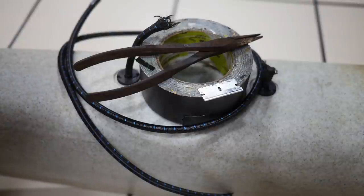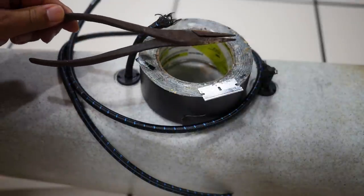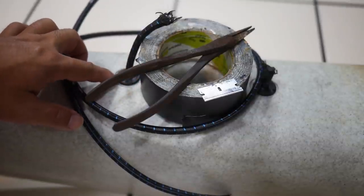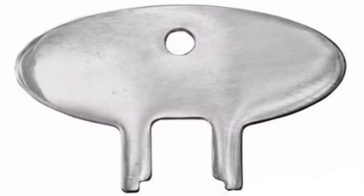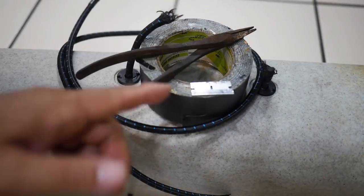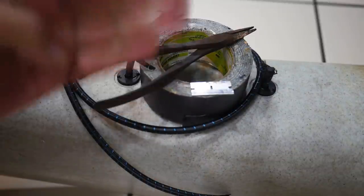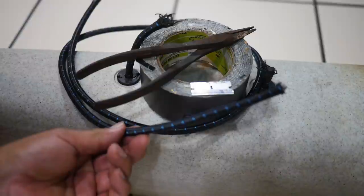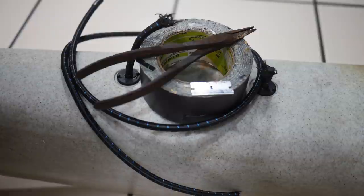Here is our equipment. I'm using a sharp needle nose pliers to take the holding caps off. You can also buy from Hobie the actual key that undoes these caps, but needle nose pliers will work fine. We're going to need a razor blade to cut the bungee cord cleanly. I'll use duct tape to wrap the bungee cord before cutting so it doesn't fray, and I got some similar diameter bungee cord replacement from West Marine.